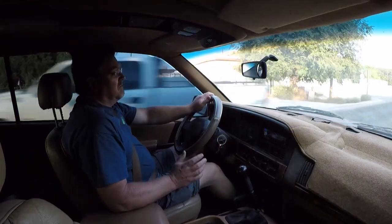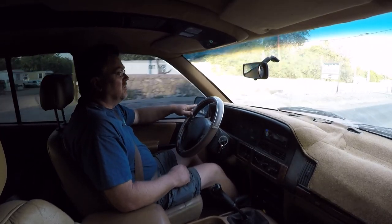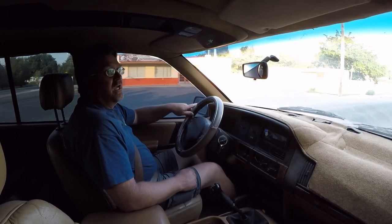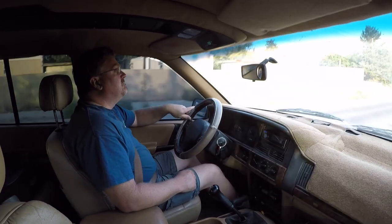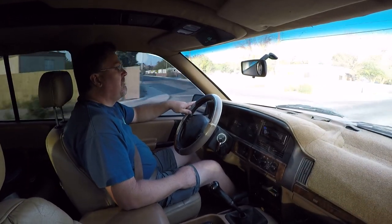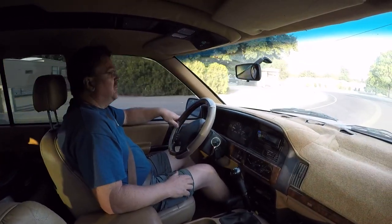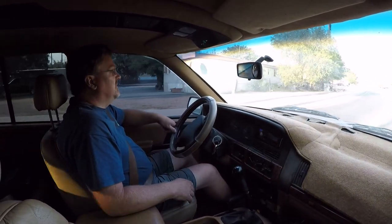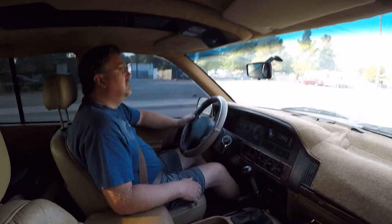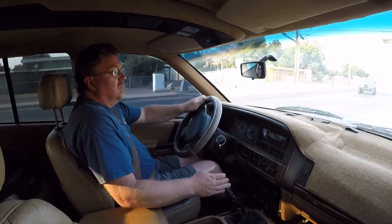Going fast, shift it maybe at 3,000 to 3,500 RPM — or even in sand or something like that. For normal driving, 2,000 RPM or so is a good engine speed, and cruising on the highway you're in that range too, a little over 2,000. It seems to be a pretty happy spot on that motor — nice and quiet and smooth. The AX15 is a good transmission. It doesn't feel like the old truck transmissions I was used to, like the M465. This thing shifts like a car pretty much — really not cumbersome, not sluggish, just drives pretty normal. It's not quite Miata-quick, but you know what is except for a Miata.